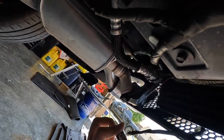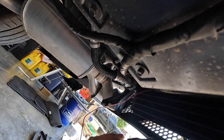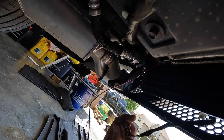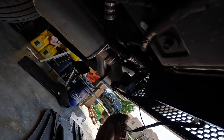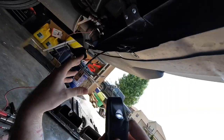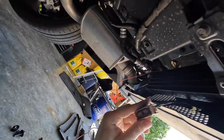Now we can see this and this is where our red wire is going to plug in at the center. Right back here there are just two wires — we want to fill in the back in the same orientation into this plug so the third brake light will function. But there's a problem: on the Mach 1 they've changed a couple of things since 2016.